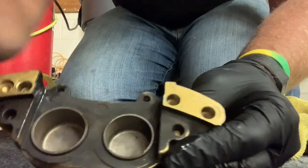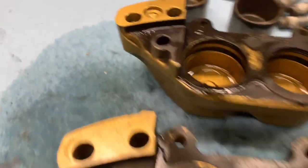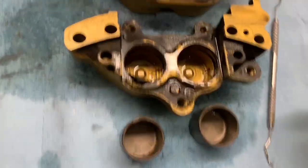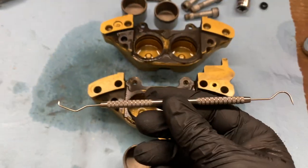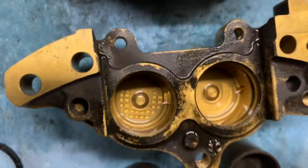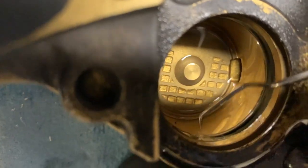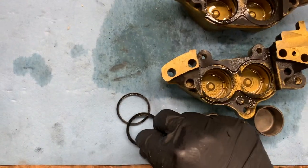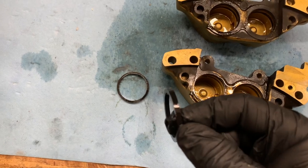Here's what both sides of the caliper look like with the piston cups removed. All four piston cups look really good — that one's got a little bit of debris, but it should clean up just fine. You've got two O-rings per cup. The top one is more of a dust boot, and I've got a $5 dental pick from Amazon to pull them out. Pull out the top one, then there's a lower one down inside. Lower O-ring comes out — each cup has two rings. The skinny one on top is the dust seal, and this one on the bottom is the actual O-ring.